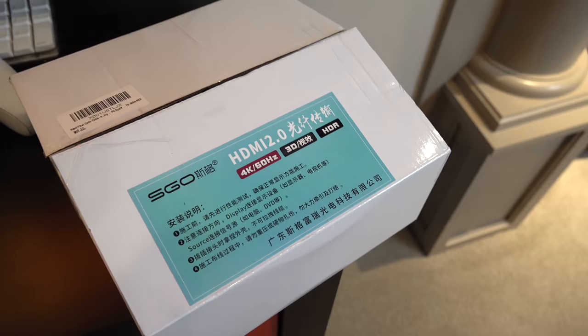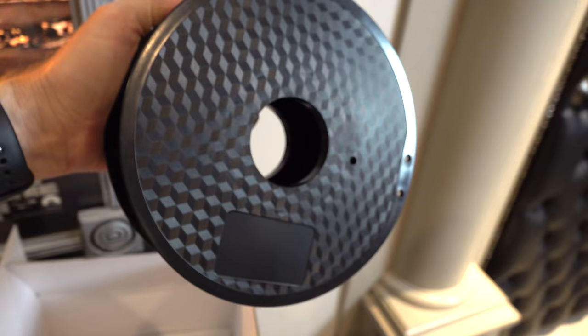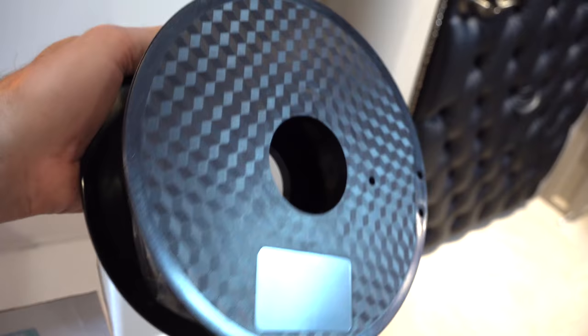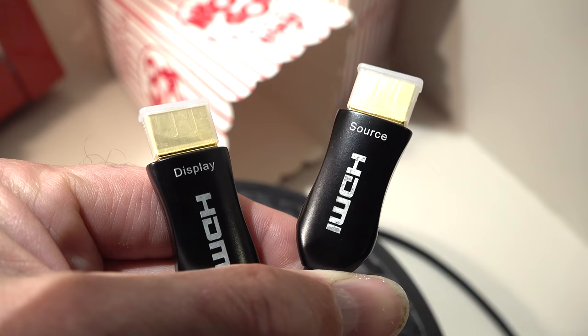The quest for Ultra HD has hit a bit of a snag. 4K requires a bigger bandwidth than the cable that I have. At standard speed, I think that's the problem, and I'm getting nothing but black screen, though I am getting sound. So I picked up an HDMI 2.0 optical — 100 feet. It runs 99% of the line in optical, so you don't have to worry about the speed slowdown, and it's rated for 4K 60Hz.